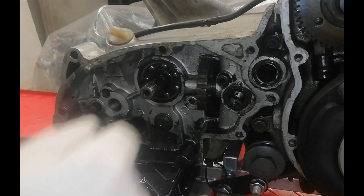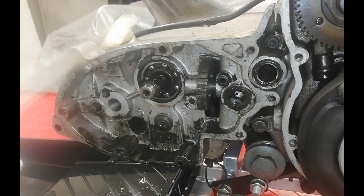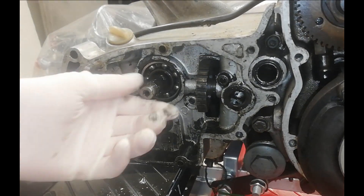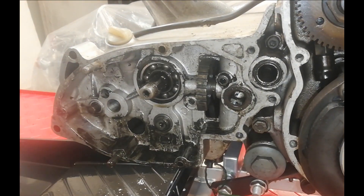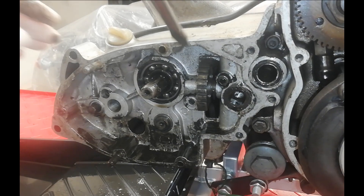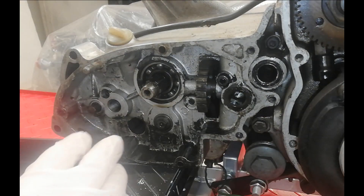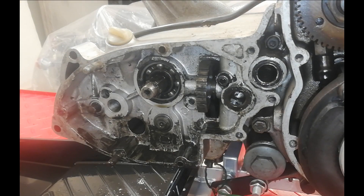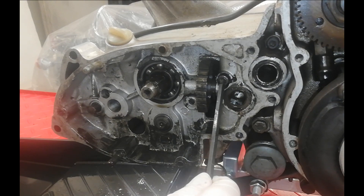This is the quadrant used for actually changing the gears. When I removed the kickstart ratchet pinion nut, I moved the quadrant around — that's now in neutral — and then I moved it up one into first, which is why I was having a bit of trouble. I put it back to neutral now. We're getting ready to remove the inner cover, which is held on by four screws: an allen key here, a large allen bolt there, and two bolts underneath.